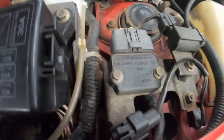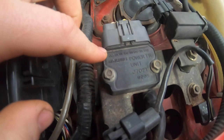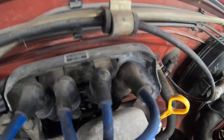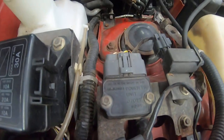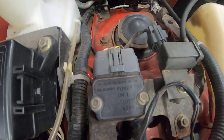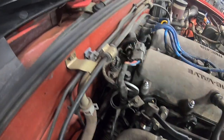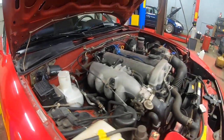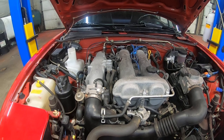This is a 1.6 specific unit — the igniter module — which is an important part of controlling the ignition coils, located on a bracket on the back of the valve cover. Fortunately we don't see many issues with it, but if you're not getting spark and you've already replaced the coils, this is something that does control the spark. Normally when a car doesn't have spark it's because of the cam angle sensor, which controls both fuel and spark. There is no crank position sensor on a 1.6 engine, so the cam angle sensor is usually the first thing to look at if you have no fuel and no spark.